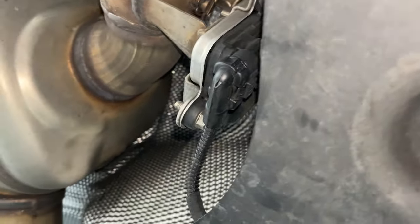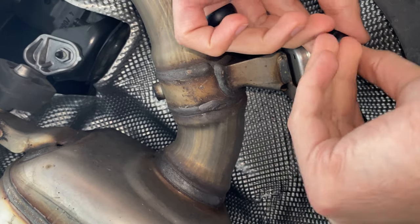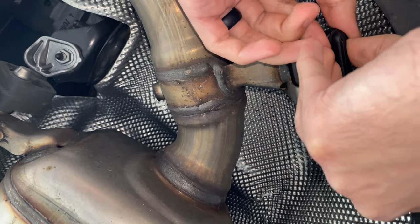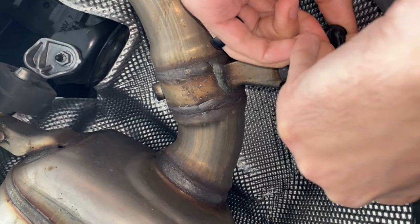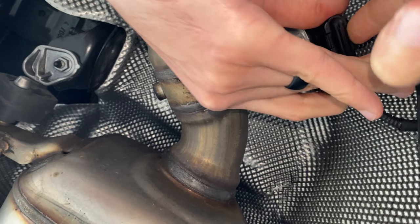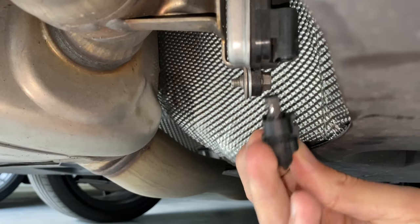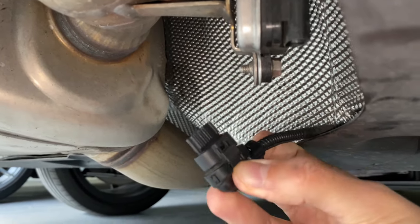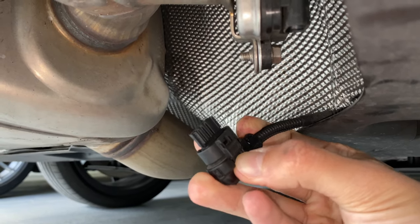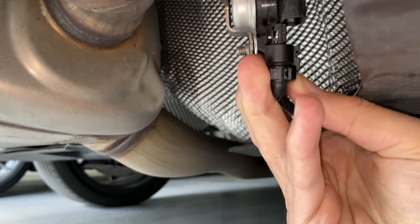As you go under the car, you'll see there's a wire going to a silver and black box. What you need to do is hold the wire in a way where you can press in the clip, which is kind of on the right side. I got it with one finger and then pulled. Once it unclips you can pull it out — you'll see it's just a wire with some contacts, and this is what gives the signal to open or close the valve.